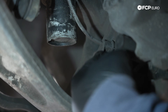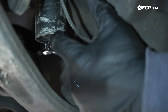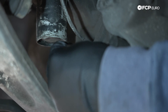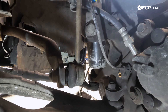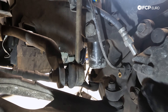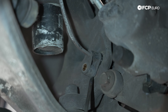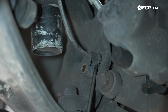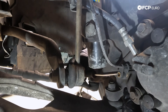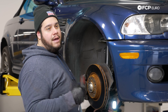Behind our assembly here, we have the sensor going into the bottom of the hub. A five millimeter hex is what's holding the bolt in place. When you're getting these off, make sure that your bit is situated all the way in so you don't risk stripping the bolt. These can be pretty corroded sometimes and they're kind of a bear to get out. With that bolt out, now we're going to work on getting the actual sensor out. This can be a bit tricky — sometimes they like to get seized into the hub. Take your time. If you need to use a small flathead screwdriver or pry tool to start working it off, just don't bend it. You don't want to break the actual sensor portion in there. With that undone, let's trace the cable the rest of the way to the junction box, get this one pulled out, and swap the new one in.